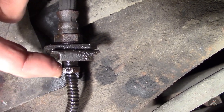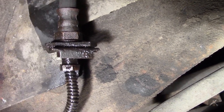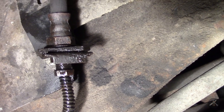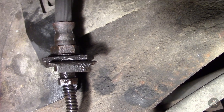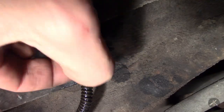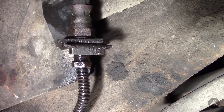Flame on the nut, and when it's done, hit it with penetrating oil, back off and let it soak, then put more water up on this fitting to keep it cool. You don't want it to burst, and you don't want a fire because the hose melts through or dumps brake fluid out. Also, this tube nut is not perfect — somebody else has been on it in years past, and that was a problem.